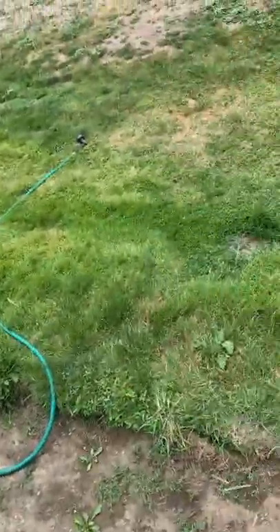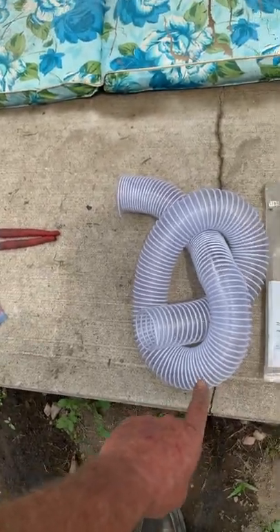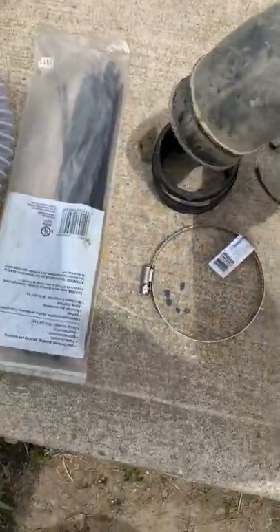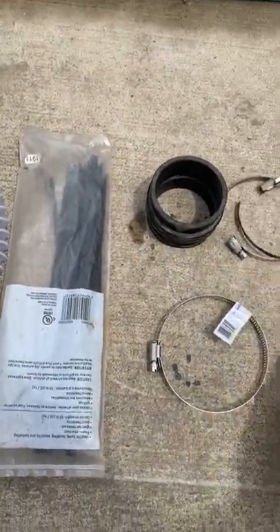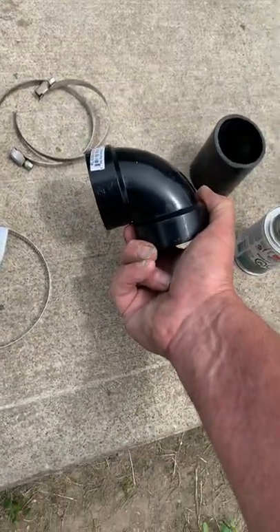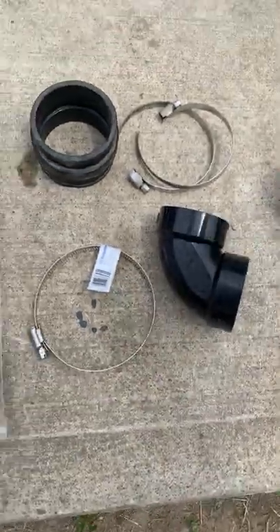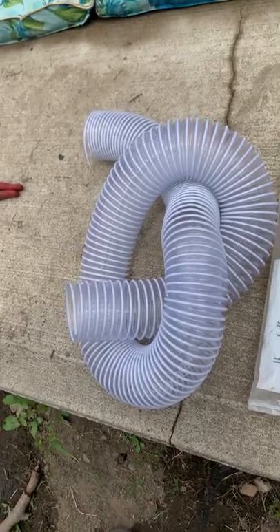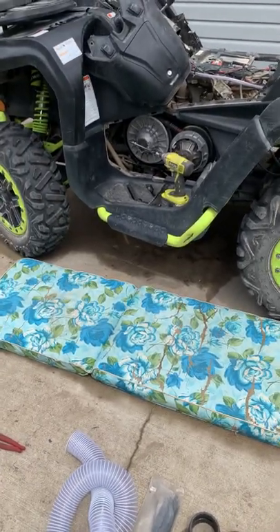Should something go wrong, and even if something doesn't go wrong, it's going to keep that belt box a lot cleaner having the air up here rather than down by the back wheels where it's covering it in dust all the time. So what do we need for parts? This is not an expensive job — it's actually really cheap. You need a length of snorkel hose, a little bag of zip ties, the factory clamps from the belt box plus one more clamp (about $2.50), a 90-degree elbow in two-inch PVC (about $2.50), and a short three-inch length of two-inch PVC tube. The most expensive part is three feet of the hose at $3.50 a foot — so that's $10. The whole job is about $20.